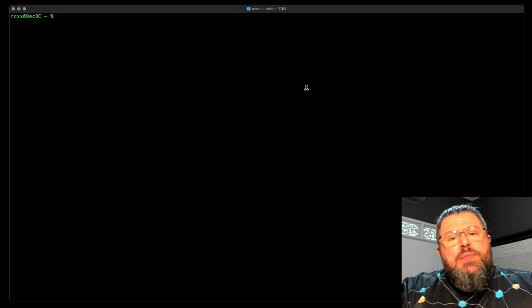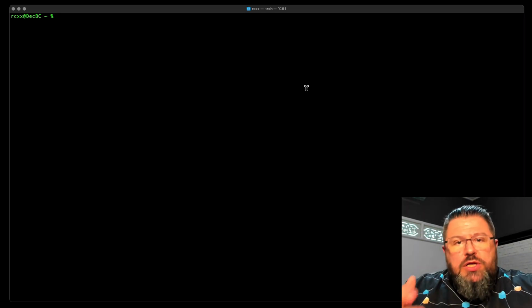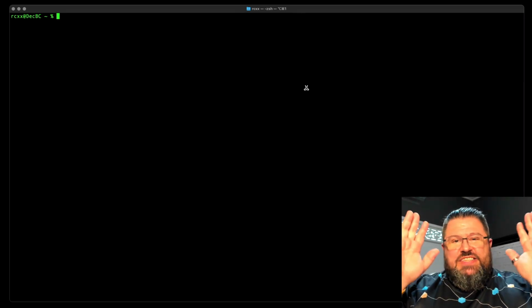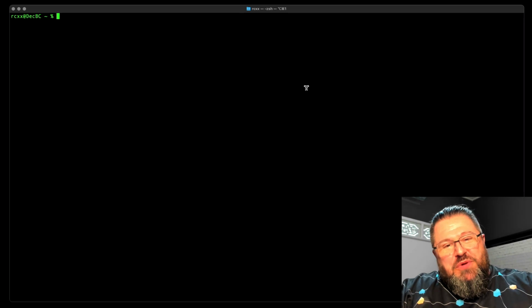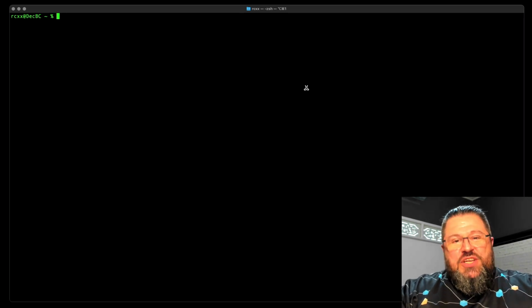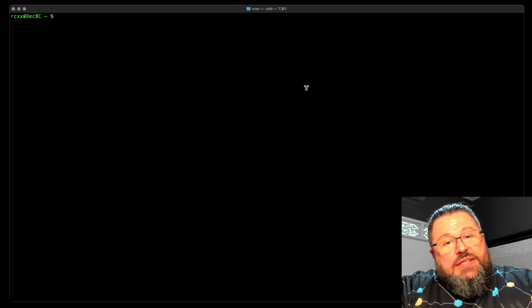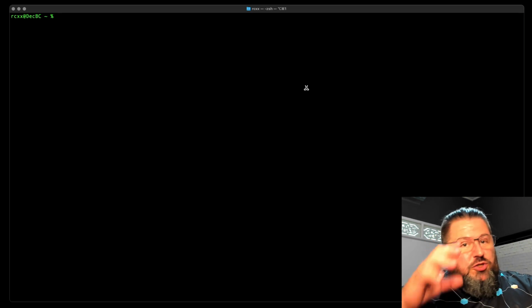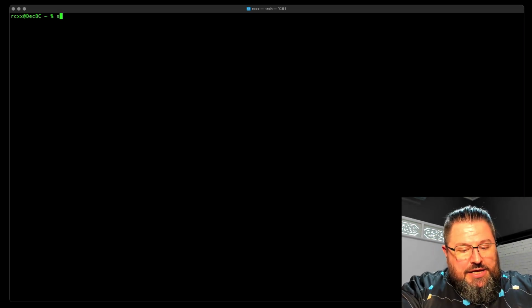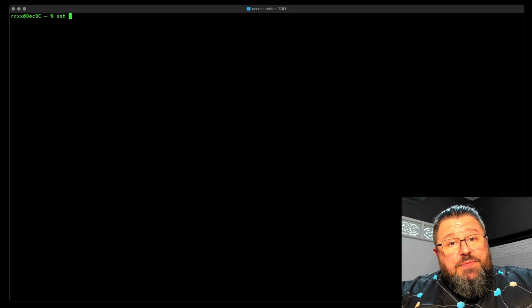If it works, I will be able to then shut it down and then reboot it with no keyboard and no monitor at all, and it's gonna be always reachable from remote with SSH, to become exactly like one of the servers that we rented from Linode and DigitalOcean. So now, moment of the truth, let's try. I try SSH. My private key is already set up inside the Raspberry Pi, so automatically I should be able to connect to the server.